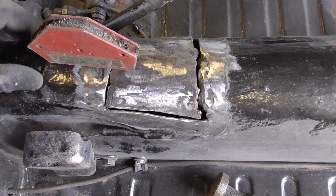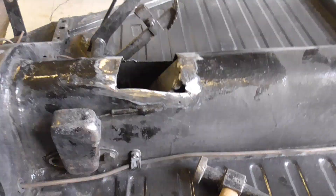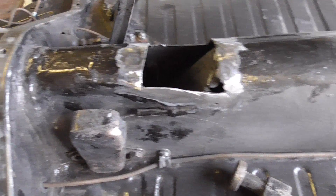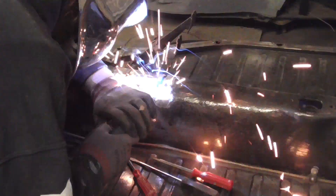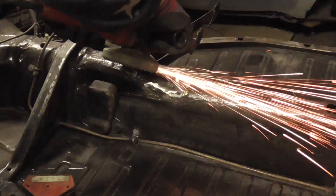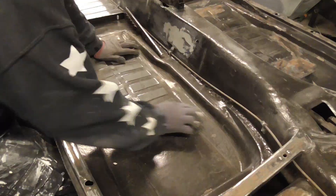I've just noticed this access panel that's been cut in the top of the tunnel — I've no idea what they were thinking. The gaps are humongous; it looks like it's been cut with a grinding disc or something — about 4–5mm. It looks a mess, but it does feel pretty solid, so whoever's done it has done a pretty solid job in there. The gearbox feels like it's running smooth, so I'm relatively confident I can close it up. Spot welds in place — some serious bridging to do now. All done, nice and solid.